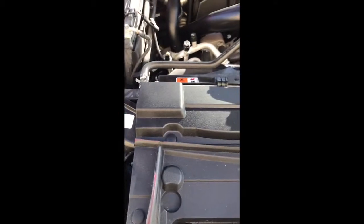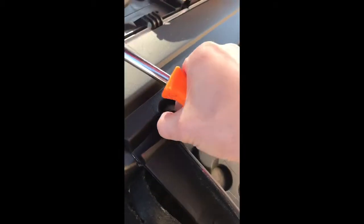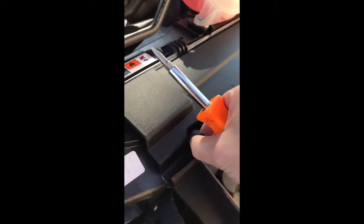All right, so when you watch the videos and the guys are like, oh, there's 12, 13, 14 clips, they're all right here, it's really easy, just pop them out real fast. Well, being really easy is definitely not the scenario. So when you look at this clip, this one lines up nice. There's a little slot on the side where you put your screwdriver in, and you just kind of side to side wiggle it until it pops up. All right, and it doesn't just come out.